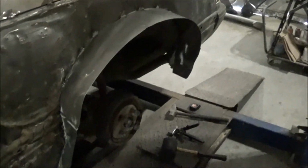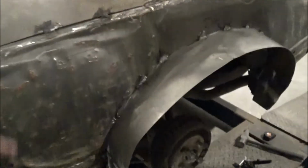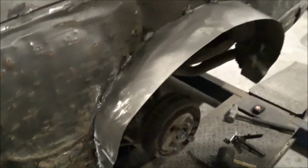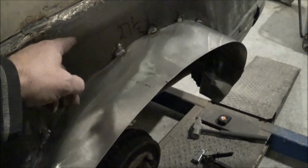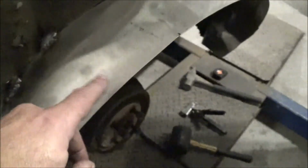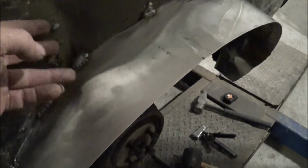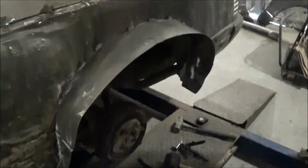And also we have the little body kit that goes under here. We've got to get all that molded in just right. But some of you wonder why I went ahead and done this. Well, this way I can go ahead and start my Bondo work on all of this quarter and get it back in shape, because I have this sticking out here. So when I make my lip that comes down, I can weld to this. That's a pretty thick stainless right there, and that's some good material. It'll weld fine. Then when my metal comes up here, of course I can bond it here with some fiberglass Bondo with some pop rivets hidden in there. But that's the main reason I done it this way, and I think it'll work out fine.